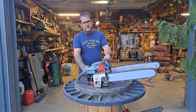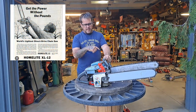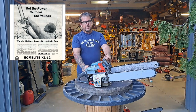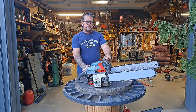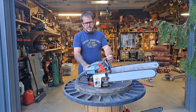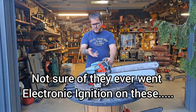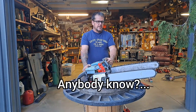I don't think I've ever gotten into the motor on one of these, maybe one of them. One of the red ones that my dad got me had the piston actually scored in it, so I had to fix that. But if they turn over and have good compression, it's going to run because it just needs tune-up parts. You can even get rid of the points and put a chip in them. Then they basically just need a carb kit and a clean up and they'll run forever.